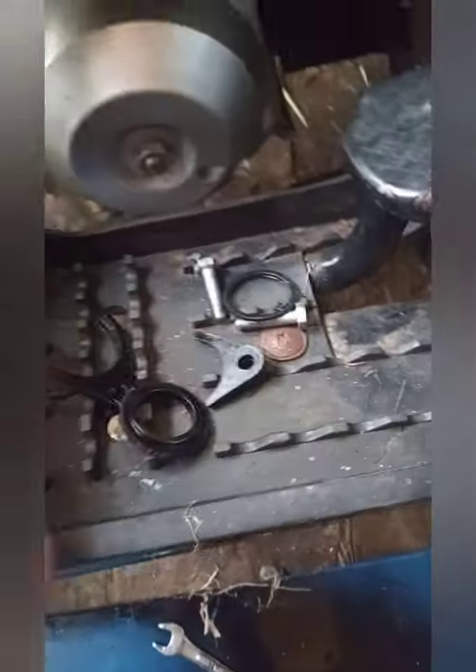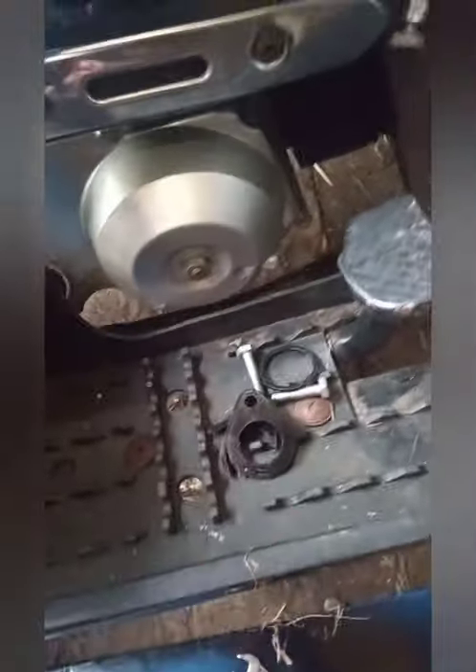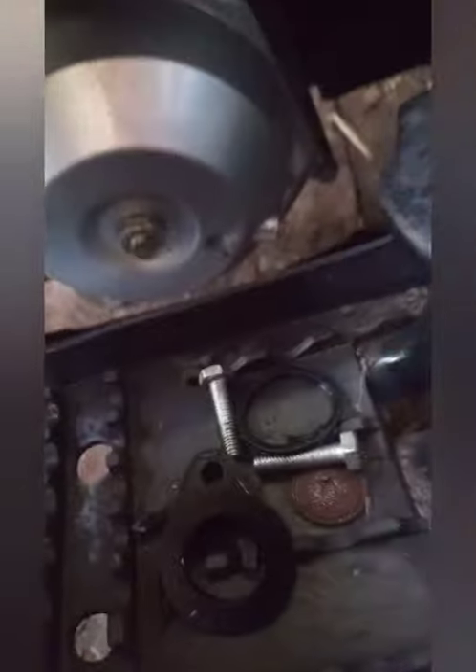All right, so I've removed the bolts already. We've got a gasket that goes between the spacer — quick thing, it broke. I might have one around here somewhere because I've got a few scrap ones, so might not be a big deal. If not, we'll have to order it. Next we go with the throttle cable, just here on top — just unscrew it like so and pull it out.